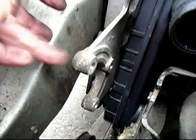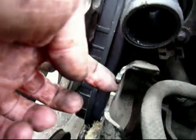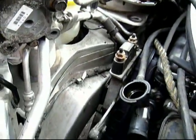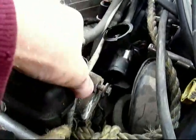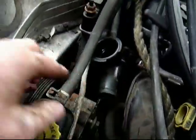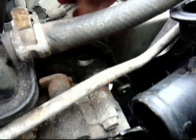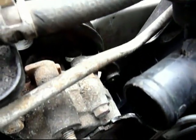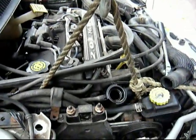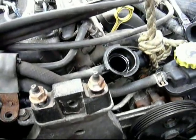Okay, we've got a 3 1/2 inch size that'll go through the power steering pump to here. And the notch here for this bolt on the power steering pump. Slide this down in here. Well, I'll slide it down in and then start feeding the bolts through the holes in the pulley here. And as long as I have the hoist here, might as well lift the engine up to be able to easily get to the bolts on the pump.